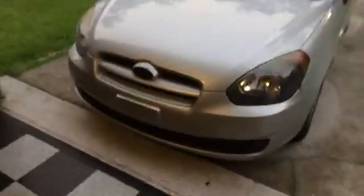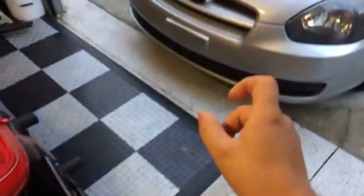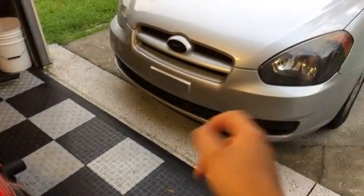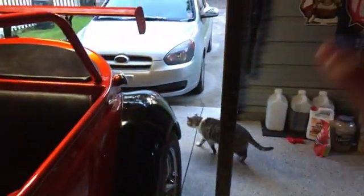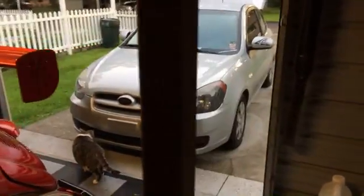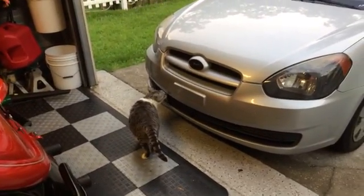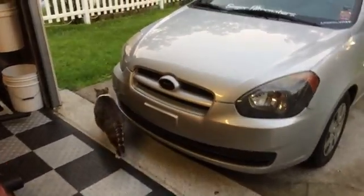What happened is Shane told me to take some WD-40, which I did, and spray it gently inside the switches and flick them back and forth a bunch. Once you're done with that, take the air hose and spray it out. Did that, cleaned up the boards, and sure enough, it is like brand new again. Just something stupid like that can fix a big issue, and could have saved me so much headache, but I would have never thought of that.